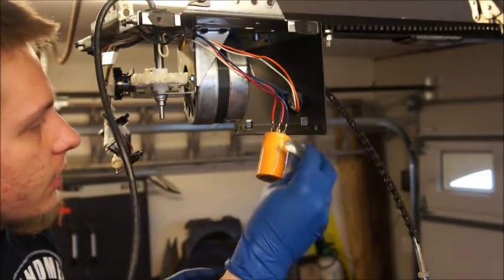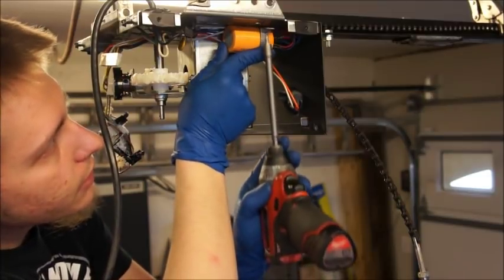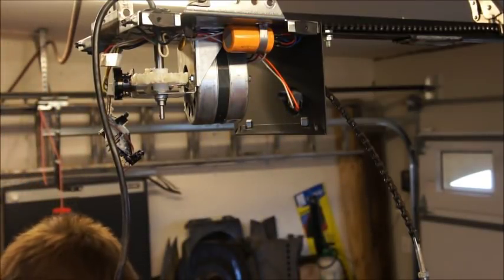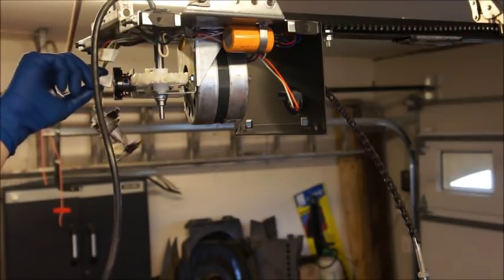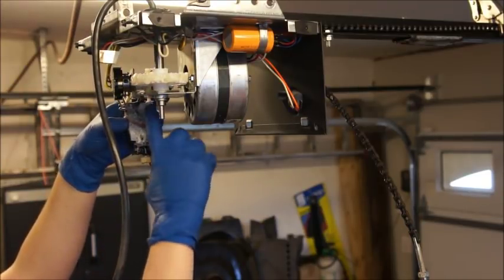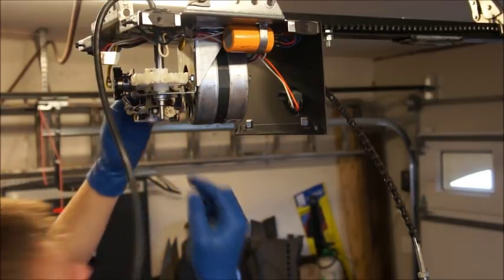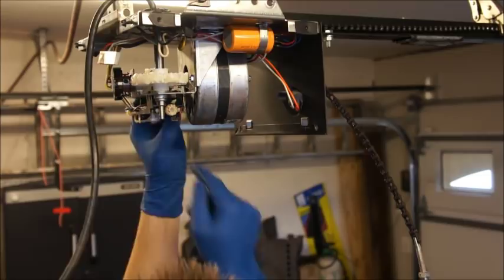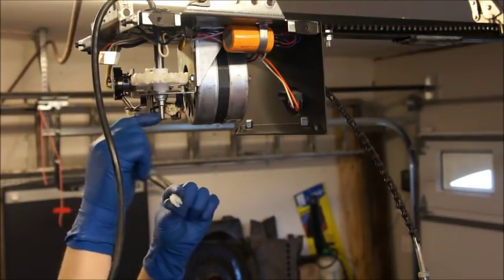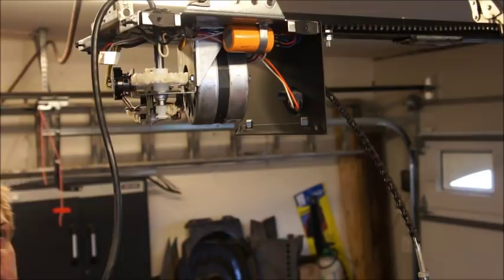The bracket sits around the capacitor — one end goes up into the chassis and the other end is where the screw goes. Just make it snug. After that, plug in the RPM sensor, take your limit assembly, push it up into the square slot in the motor plate, rotate it, and put the two clips in the two square holes. Double-check that they're both seated in there. Then take your limit gear, line up the slot in it with the hole, push it straight up, take your W-clip and run it through the hole — it snaps in and you're good to go.